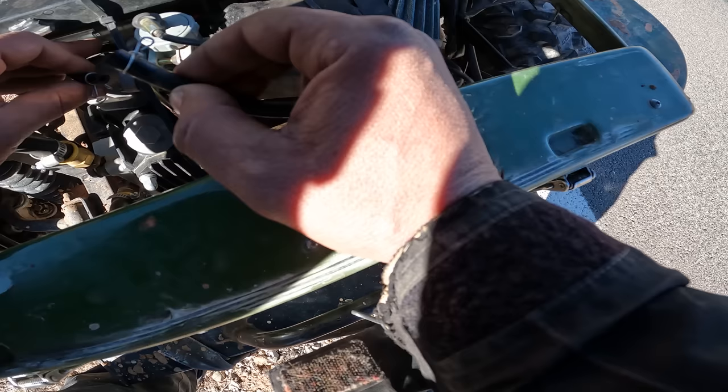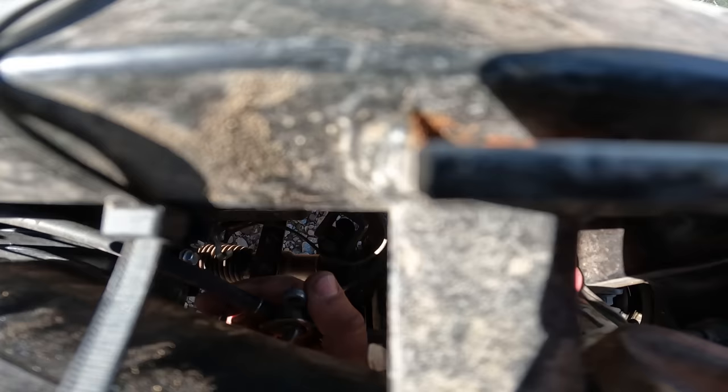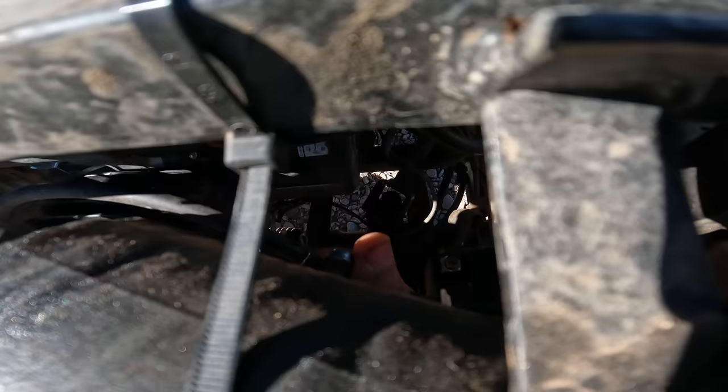So what was the cause? Why's that vacuum tap off? Well, the very stiff valve for the vacuum feed to the fuel pump was completely shut. Meaning the fuel pump couldn't operate. And no, I have no idea how that happened. Right, well, let's open you. Right, you're now open. With the valve now open, I just needed to prime the fuel system.